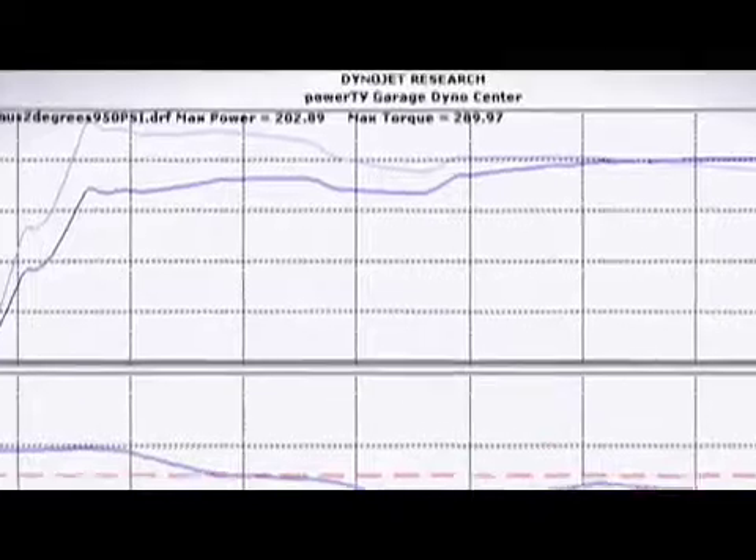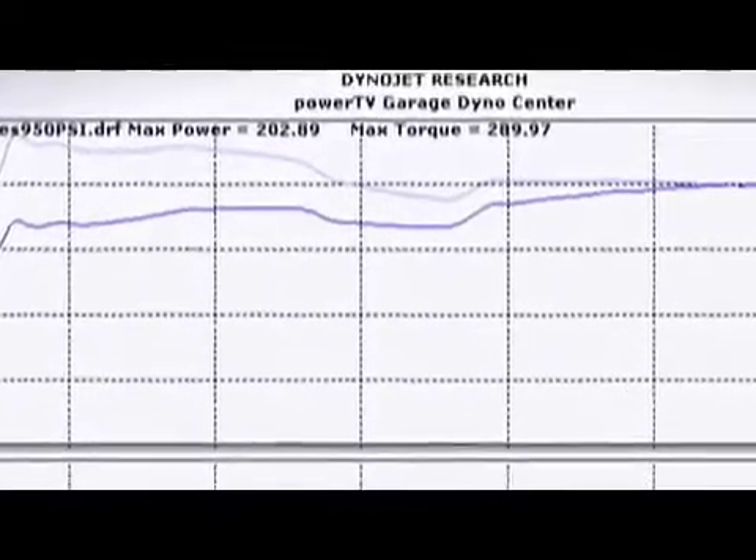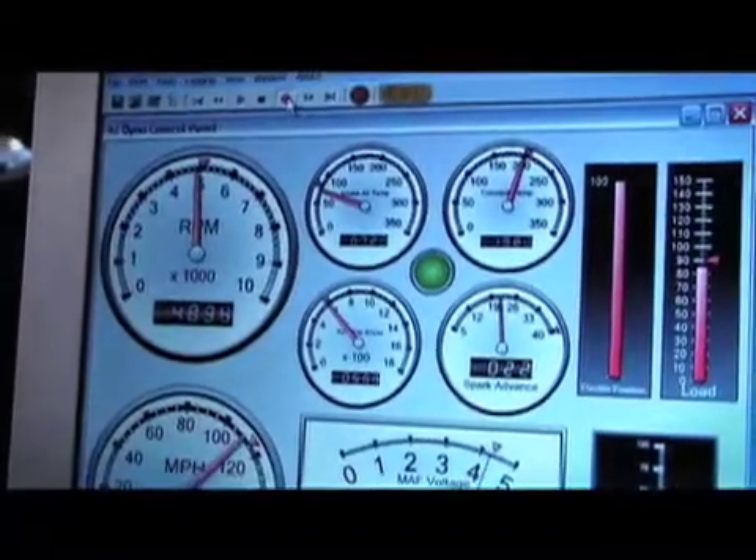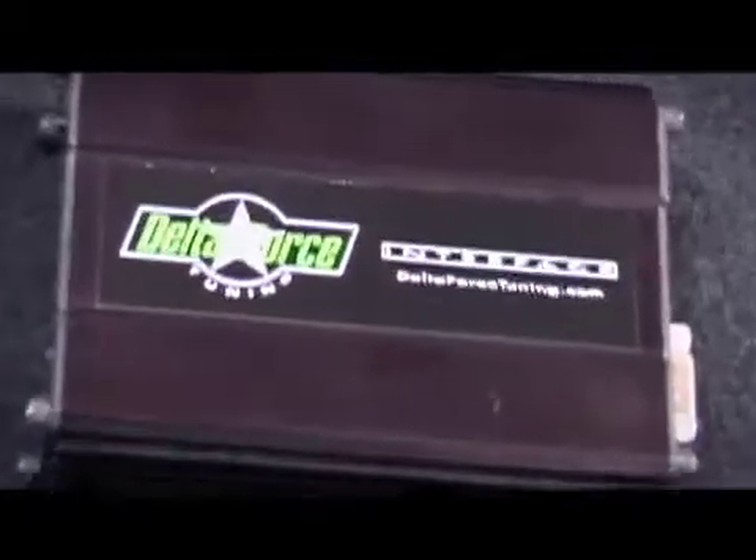The gains on the 50-shot increased horsepower by 50 and torque by 91 pound-feet. Overall, the K&N intake and Zex nitrous kit performed great, and we were able to data log the runs as we made changes along the way. The Commando tuning software by Sniper gave us exactly what we needed to create great power on and off the nitrous.